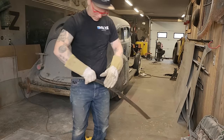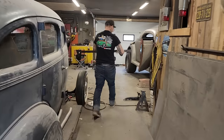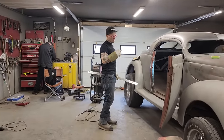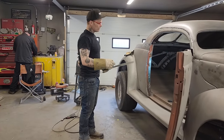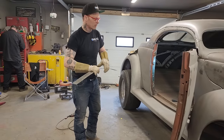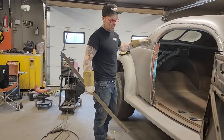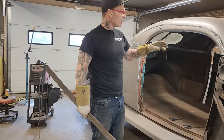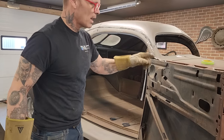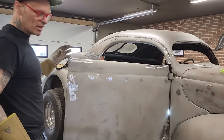When you're putting metal on your car, like I do all the time, it's going to be painted, it's going to be primed, it's going to be whatever. All your metal should be primed or sanded, every time you do something. You cannot put a piece in a car and not sand it and then expect something to adhere to it. And I do it a lot, I really do: I put a piece of metal in a car, and then I just leave it for a while and do not sand or polish it.